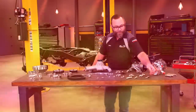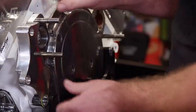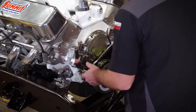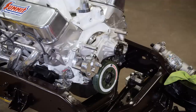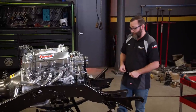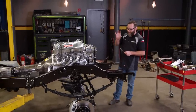The first thing to be installed is going to be these studs right here. A little black RTV on these studs. One nice thing about this kit is the way the water passages are sealed — they use O-rings, which makes installation nice and easy and prevents leaks. Put a little anti-seize on there. Time for the water pump. Then we can start installing the rest of the accessories one at a time. Another great thing about this kit is that it's compact and doesn't take up a bunch of room in your engine bay. That looks really nice. I would say it's a little too nice for this truck, but actually it's not — because once the rest of this truck gets assembled, this is going to fit right in. This is going to be a really, really nice truck.